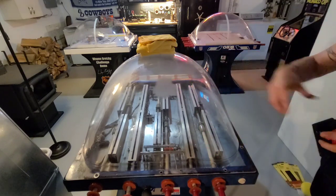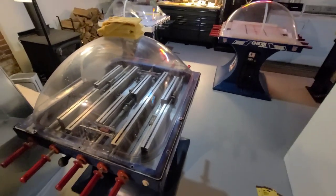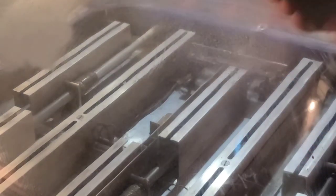I do have another scratch here that we'll start on — I'll show you how I do it. Just right through here I've got a couple of scratches you can feel by hand, so I'll start on that one. Get a little wet on your sandpaper. With the same grit sandpaper, you want to go the same direction every time — that's the key. When you switch grits, you'll put a different stroke on it — go back and forth or put a little angle on it. Just go at a different angle with each different grit sandpaper.